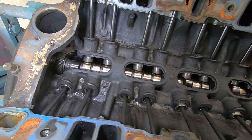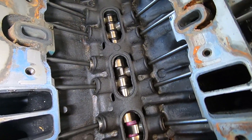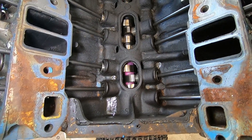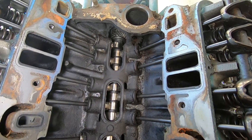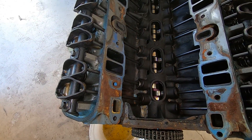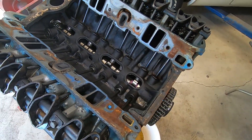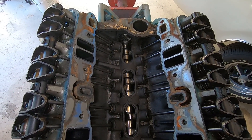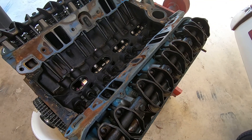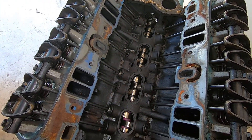So here's the plan. I'm still going to disassemble this motor even though it looks really good, and now I've got some decisions to make. I'm going to look up the number and specifications on this camshaft, pull it out and inspect it really good. Here's the dilemma — the question a lot of people have on a used camshaft: is this camshaft good enough to put right back in and use it once I find out the performance specs on it? It may save me some money on having to buy a camshaft. I already have a camshaft for this motor — it's a very mild, barely above stock camshaft, the one I bought for the 318, but it's also a 318/360 camshaft. From what I understand, it's just about what the specs were for a stock 360 four-barrel engine — even though it's slightly hotter for a 318, it's actually a 360 four-barrel camshaft or just slightly hotter than that.